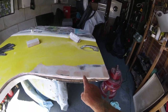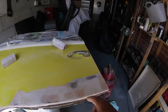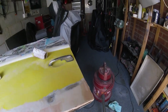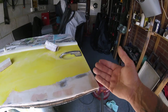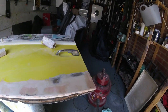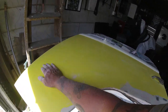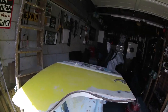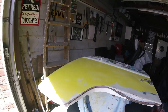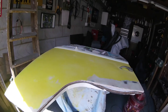You can see where I just filled the holes and little pits. When I first started mixing this I thought I hadn't mixed it properly because of these little red bits - but the red bits are because I was mixing it up on an old L plate and the red was coming off. So that should be fine. It won't take long for that to go off. I've actually rubbed the whole door down with some fine paper - as you can see it's all dusty. I'm going to give that a wipe off and clean it up. I think it's time to get some primer on it.